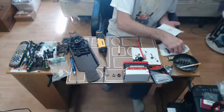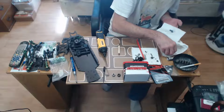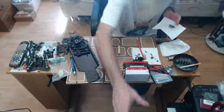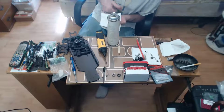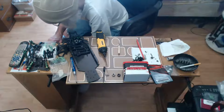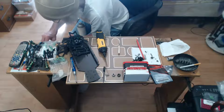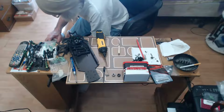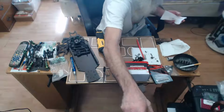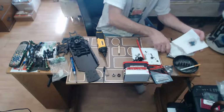I spray these off real good again and try to drive any crap out. I could pop a seal out, but when you pop a seal on a new bearing, especially a ceramic, if you ain't really careful, you end up screwing up the edge of the seal, and then it doesn't seal. And then you get crap in there real easy. So over a good heavy spray on this side. There. Slap me back on this one.